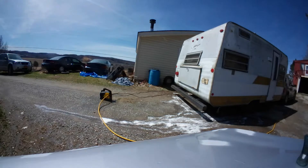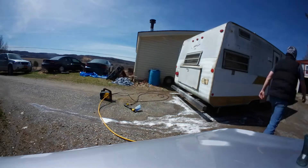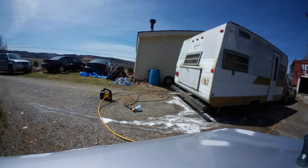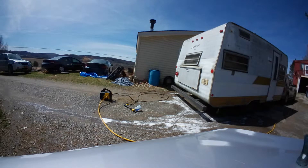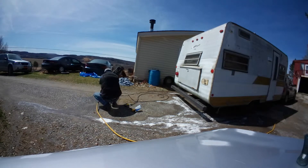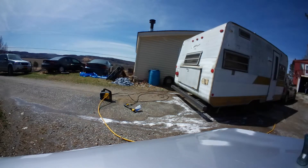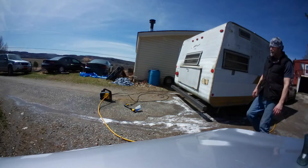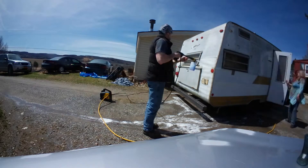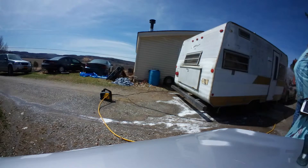Again, make sure you get all the air out of your water hose. Eventually it worked great — the pump will automatically shut off when you stop spraying, as long as you have water pressure going into it. If air gets into the pump, the pump will keep running. It was really light — I was able to move it around, just a bit clumsy managing the electric cord, high-pressure hose, and water hose together.